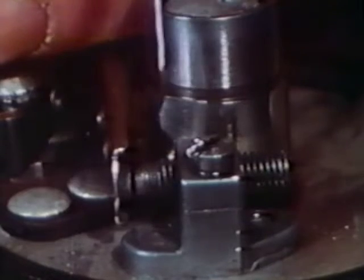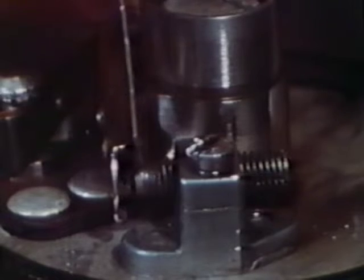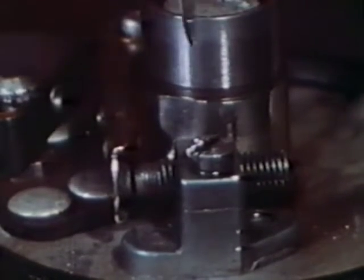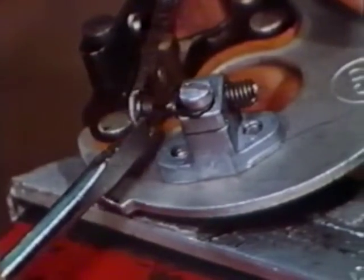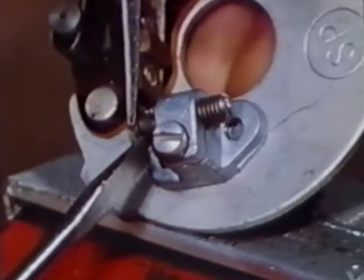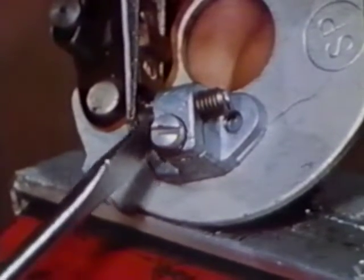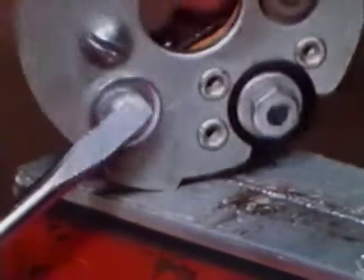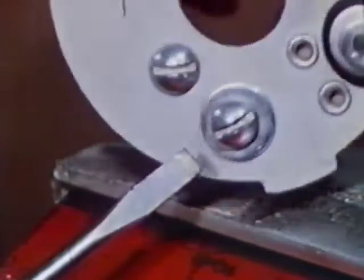You can do this, if you like, in a go/no-go manner with blade sizes just under and over the gap you want. Now take a good look at the point surfaces too, and make sure they are clean, that they meet flat and square with each other, and that they contact each other over the entire point surface. If they don't, adjust them by loosening the fixed point block and move it axially until you get flat and complete contact.